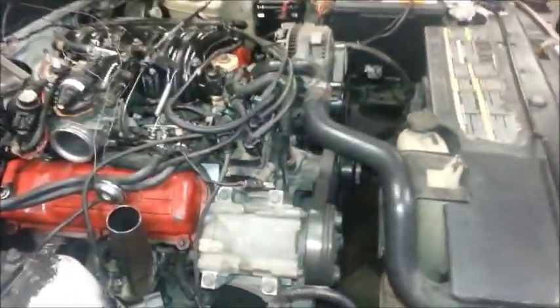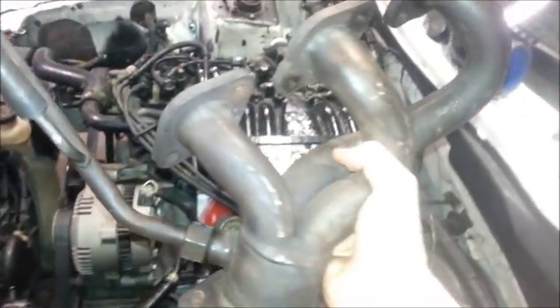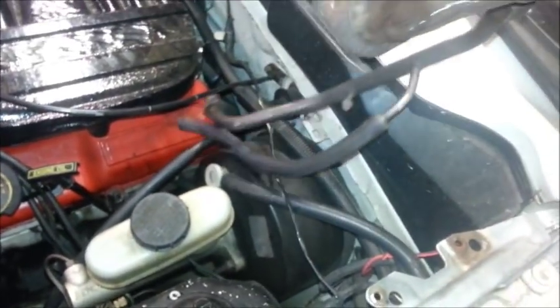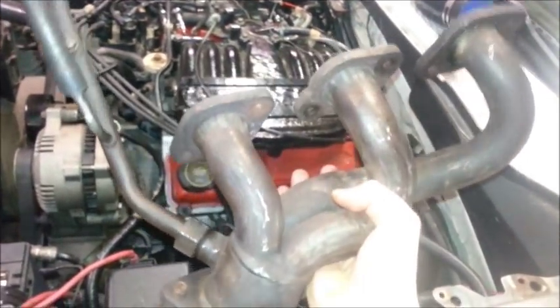So I have this side done now I'm wondering about that side. This was originally on that side and had the EGR tube and the little bolts angled down there, but if I flip it, it would run into the brake booster right here. So I can't do that — I'm going to have to cut and re-angle the tubes just like I did on that side.